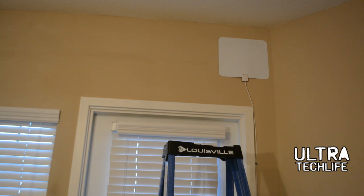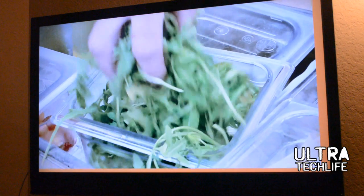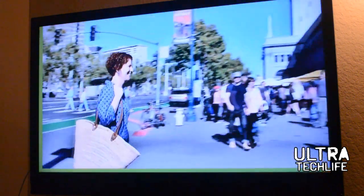You can see we're beginning to hide the cable — it's very thin and doesn't look too bad. Once you decide on placement, the next step is to do an auto program scan. Set your TV to air through the television's menu and let it search for digital channels. Since the 2009 switchover, the average inner city is going to have a lot of these channels. Most people paying for basic cable to get local channels are paying 30 bucks a month — and these are available for free.